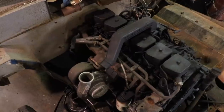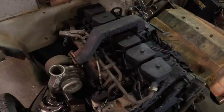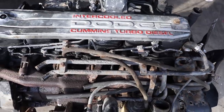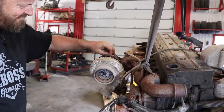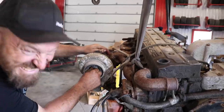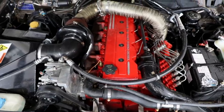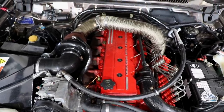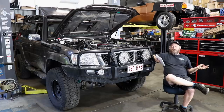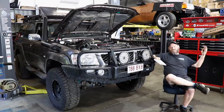The oldest one is a 12-valve VE pump, so it's got a rotary injection pump on it. The next one up is the P-Pump 12-valve engine, which is the one that people froth on. Then we've got 24-valve, which is what the top half of this engine is, with a VP pump - an electronic rotary pump. Then we've got 24-valve with a P-Pump, which is this exact setup - that's not a factory engine, that's a customised hybrid. Then we've got 24-valve common rail, using a much more modern injection system. And then we've got the 6.7 litre, which is a very late model.